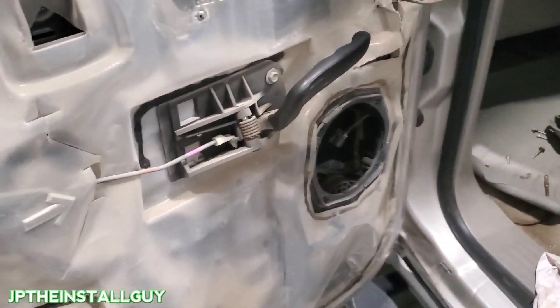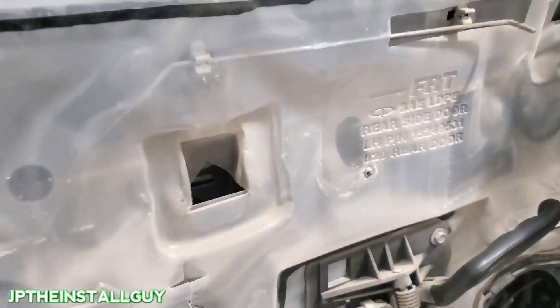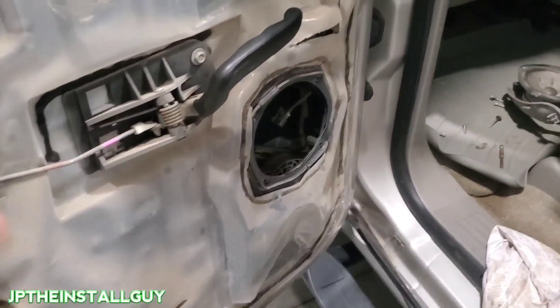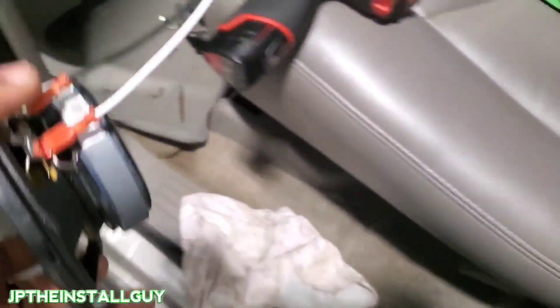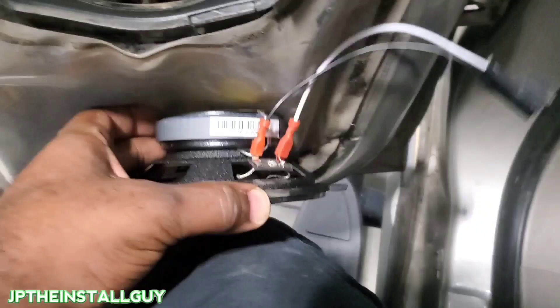The main reason I'm able to keep this video under 10 minutes is because I have all the proper parts. We've taken the front door panel off and the rear door panel off. If you're doing all four speakers it's probably going to take you 20 minutes, but that's still better than two hours worth of work. We've got our 5.25-inch speaker here — it's just a Kicker speaker — but the most important thing is that we have the speaker harness, which takes out all the guesswork so we don't have to figure out positive and negative.